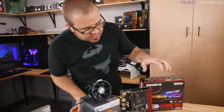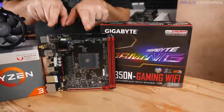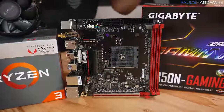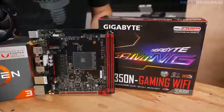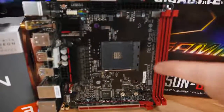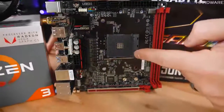There are eight main components to a desktop computer you're going to build yourself, starting with what holds everything together — the motherboard. This is a Mini-ITX motherboard, which means it's very small. Form factor is important: the Mini-ITX form factor is going to impact what case you choose. You also want to make sure that the socket at the center is compatible with your processor. The socket we're using today is AMD's AM4, which is compatible with our AMD Ryzen 3 2200G APU.